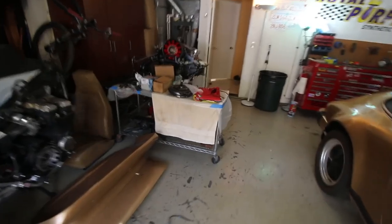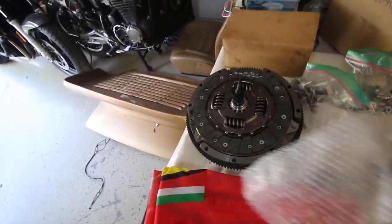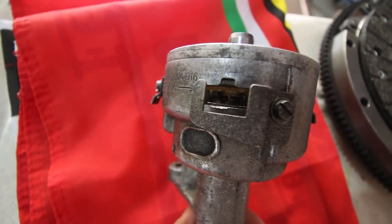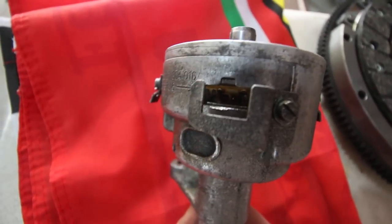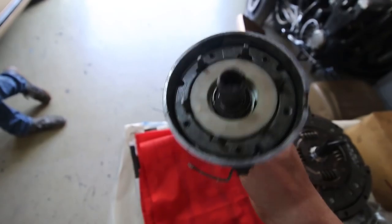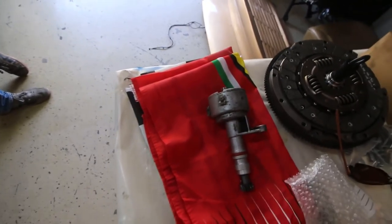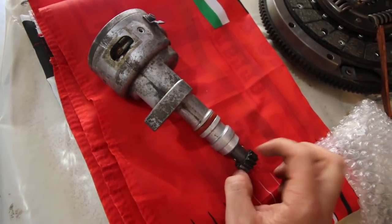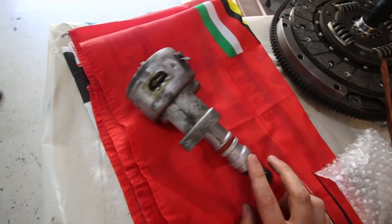But here comes all the negativeness and the bad news that just seems to plague us sometimes. This thing is just a gigantic piece of crap. If you look at the connector, there are pieces of plastic — the female side of the connector for the spark output, that green wire — pieces of it are broken off in there and we can't get the Allen bolts off to clean it. This whole thing looks like it's been underwater. We brought it to the machine shop today and that's exactly what they said: 'Man, this thing looks awful, it looks like it's been underwater.' They basically didn't want to mess with it — they would switch out the gear but wouldn't do anything else. I think we're gonna backtrack — the EDIS is a better system anyway, but for first start and ease of doing everything quickly we were going to go with the distributor, but we're just gonna say screw it.